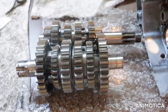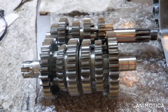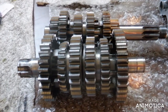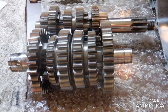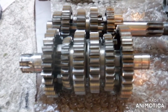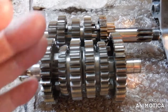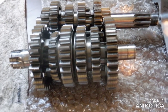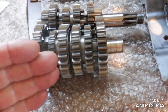I had the crankshaft pressed in on the left side because that's what the manual says — the machinist said yeah it should be okay that way. I get back home and the manual on the next page says press it in on the right. It really shouldn't matter but it does, because I could not get this thing to shift properly no matter what I did for about four hours. I have no explanation for that. So I put it in on the right side. It just slips together and shifts smoother than you know what. You need to press the crank in on the right and you can put the transmission in on the right.